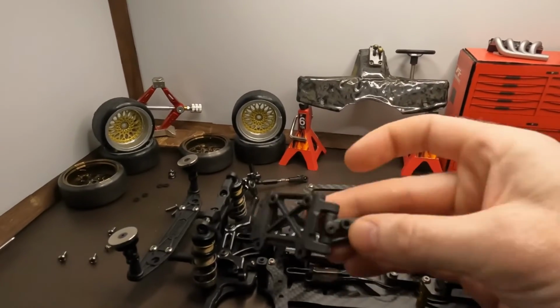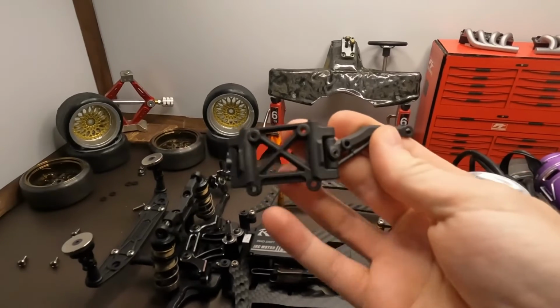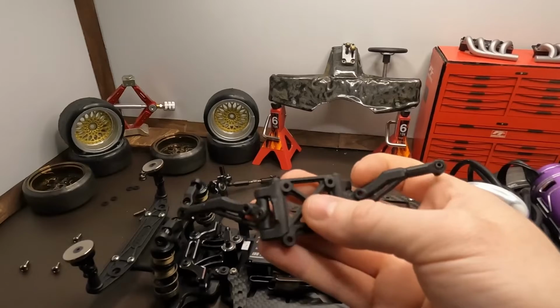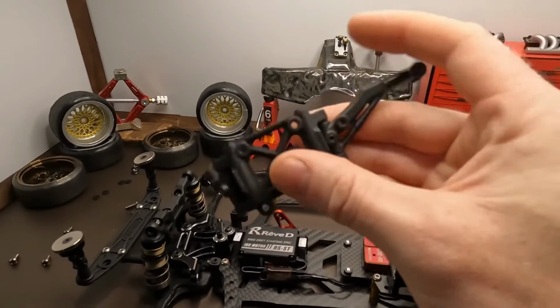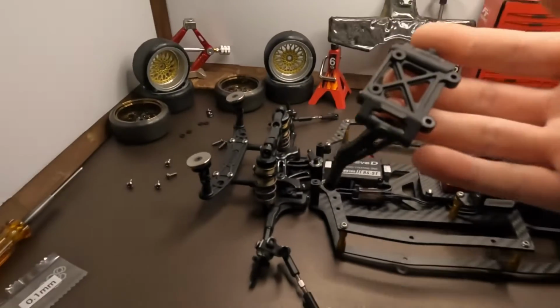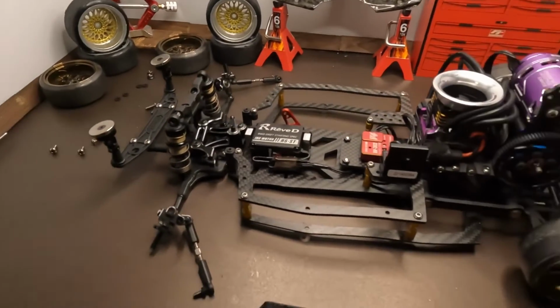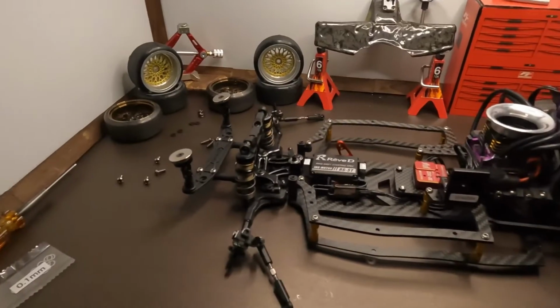If you could see this, I have my spacer in front of the arm, and then just a tiny shim just to tighten up the movement in the arm, so there's no slack really. We'll get this button up and we'll take a look at the Ackerman angle and geometry and just see if everything's kind of the same as it was with the old plastic. So I'll get these bolted on, be right back.